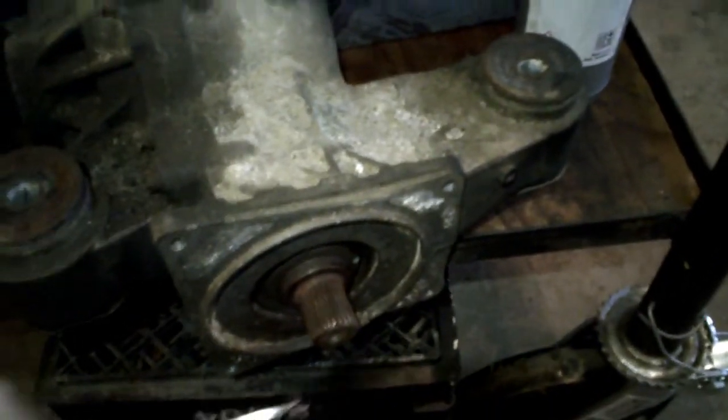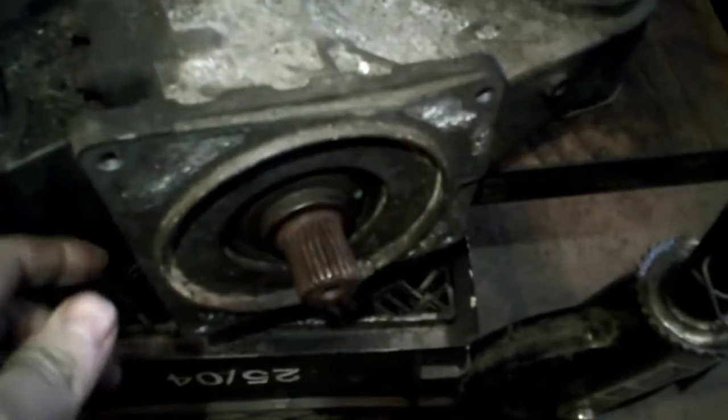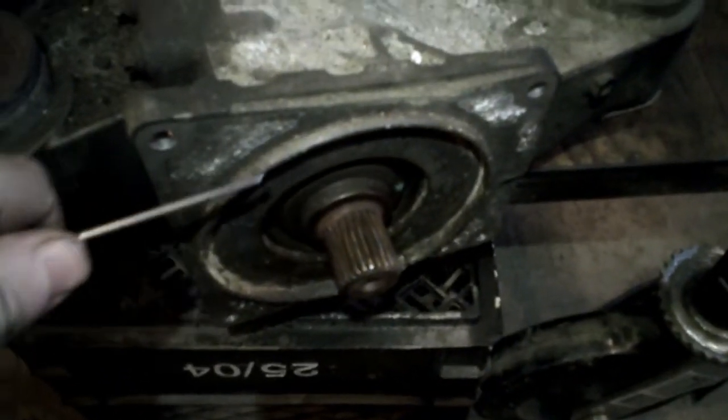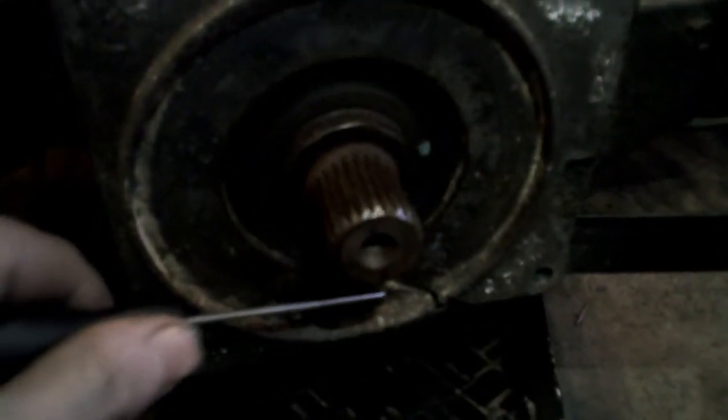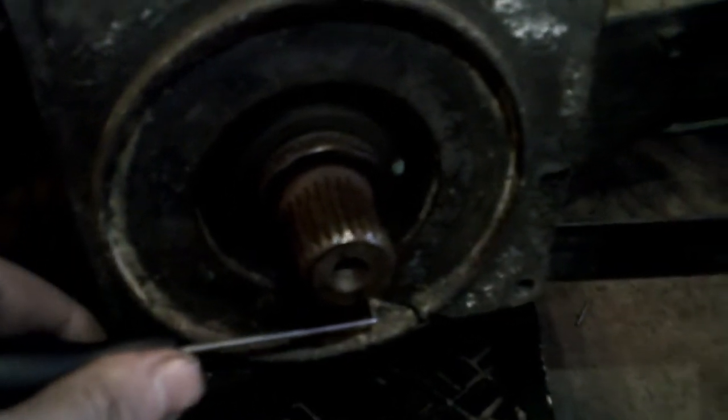And I know people will say, yes, but what if the seal is just worn out and broken? Well, on the rear section where it's mating with the center section, you can see here that I think every unit has a notch right there, and this notch is, in my opinion, preventing the two fluids from mixing up, because chances are that if you have a worn out seal on either of the sections, the fluid will just leak out and go on the floor.